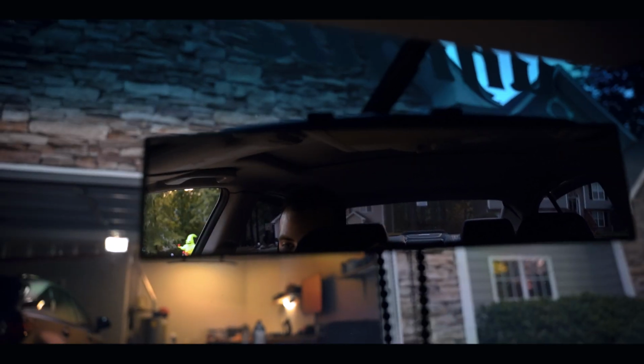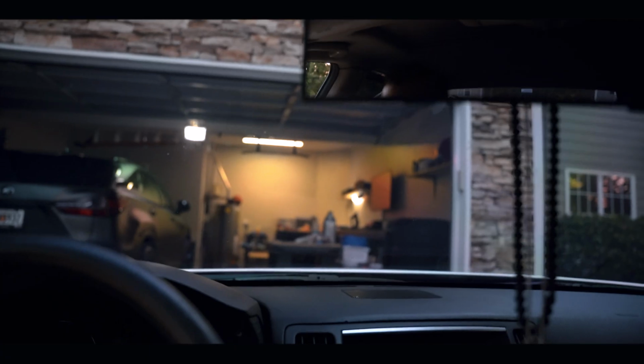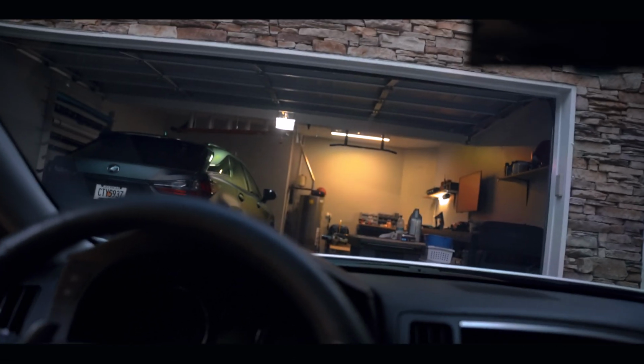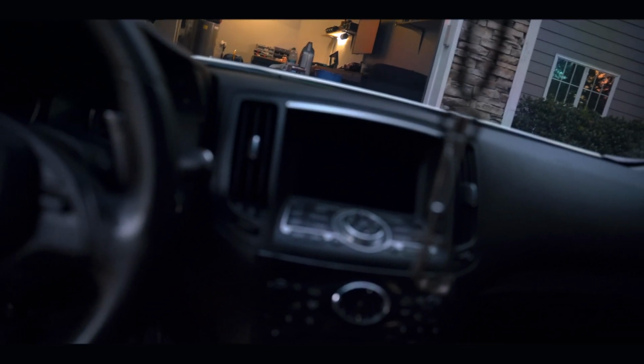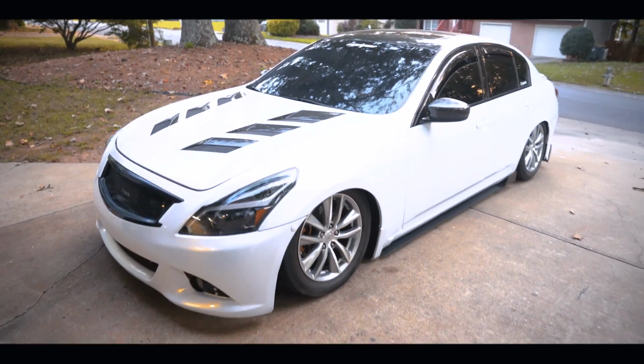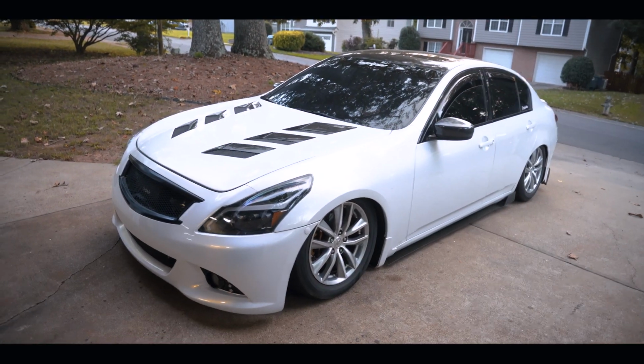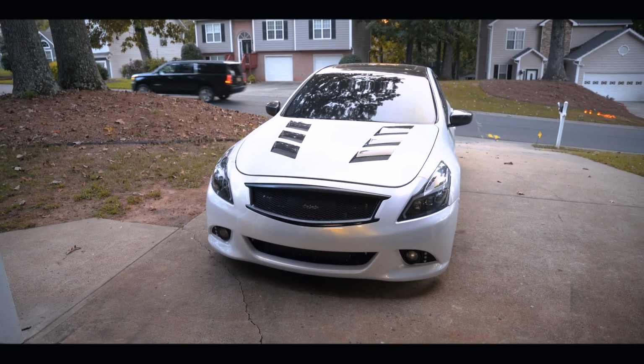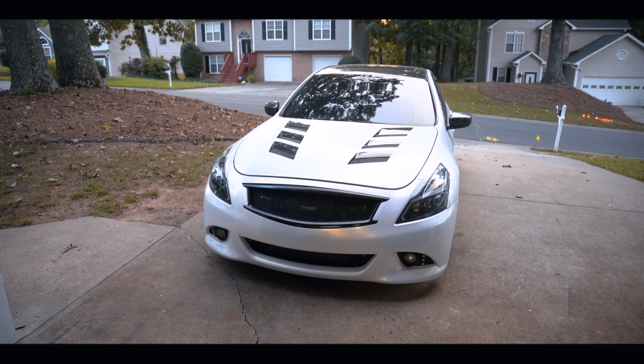So there's power going in the rear view mirror. I think one of those wires, he said, was loose, so it was causing a short because it was rubbing with the other wire. He said he put the car on, he had a new fuse in there, and as soon as he touched those two wires up there, the fuse blew and everything went dead. So I just think it's crazy he figured out what was causing it, because like I said, there were like 20 things it could have been, but he narrowed it down that quick and figured out it was the rear view mirror. Which is wild because I never touched it. I never did anything to the rear view mirror. So I guess it's just one of those things that can kind of wiggle loose after so long. So he took care of me.